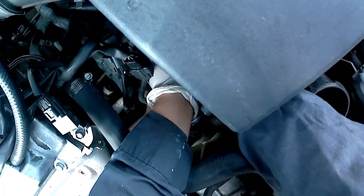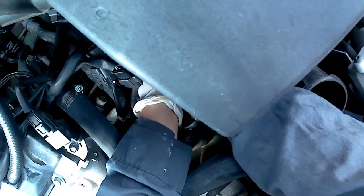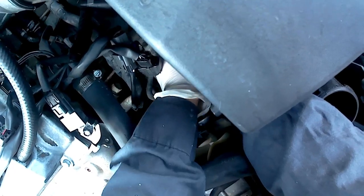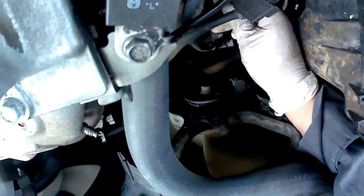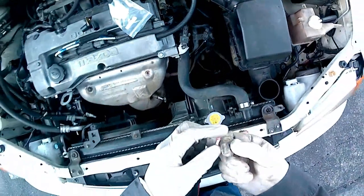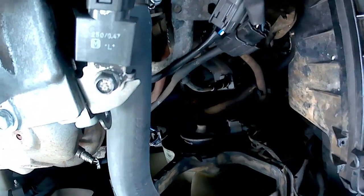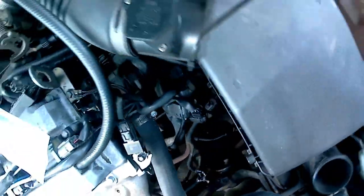I try to keep my engine as clean as possible. Just wiggling, prying it up, lifting on that tab slowly. It did let go — there you go. It came off from the sensor. I'm cleaning off that area because some pieces broke off on that little tab, but the locking mechanism is still intact. I worked on it slow, so just be gentle.